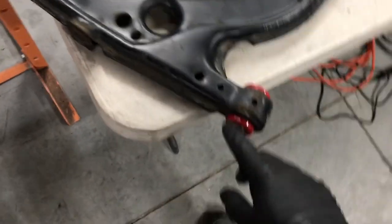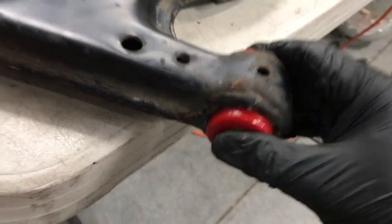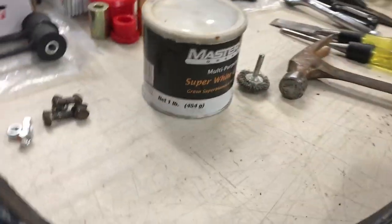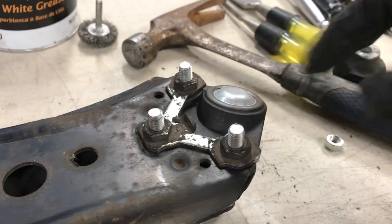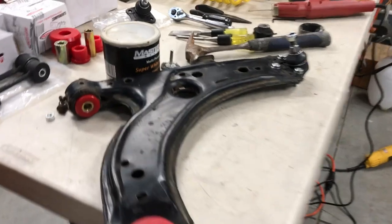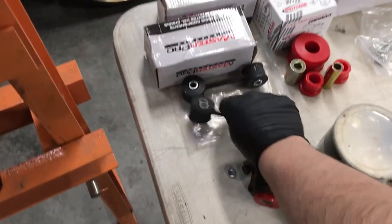I cleaned it up a little, got the new bushings in. For this one I did use a press to push it in. Make sure you lube them up really well — I used multi-purpose grease. After taking the bushings out, I used a drill with some cleaning wheels to clean the inside edges, then wiped them down and lubed everything up. The smaller one I was actually able to get out with a hammer, just tapping it until it came out. The larger one was a pain because of the metal ring, but both are out now and new bushings are in. I lubed up the metal on the inside, the bushing itself, and the center metal part. Got the new ball joint in with all new hardware, and the control arm is technically done and ready to go in.